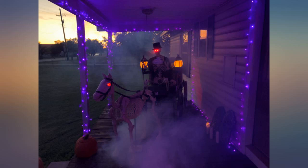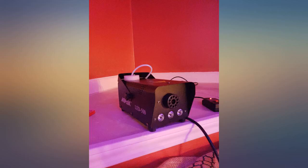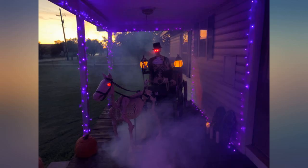I let it cool down. Finally, I removed the filter on the end of the hose and submerged it again. This time the hose drew fluid into the unit and it worked. Make sure the clear plastic hose has fluid in it before going crazy hitting the button — the pump needs to prime. You might have to take off the filter on the end of the hose first to prime the pump.